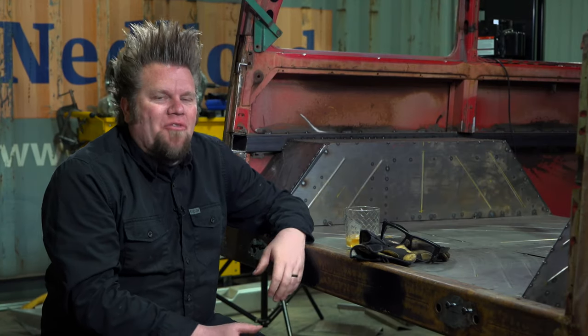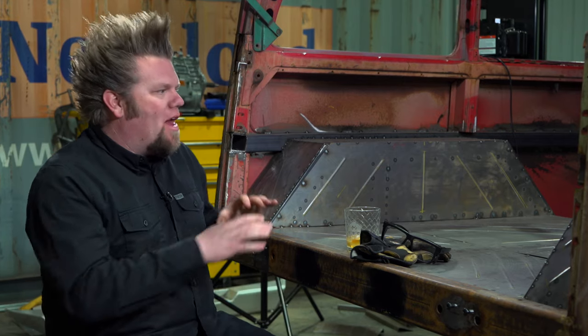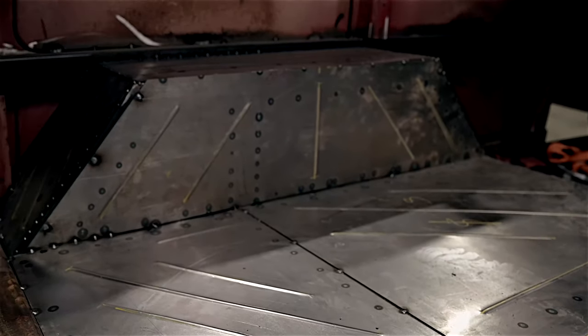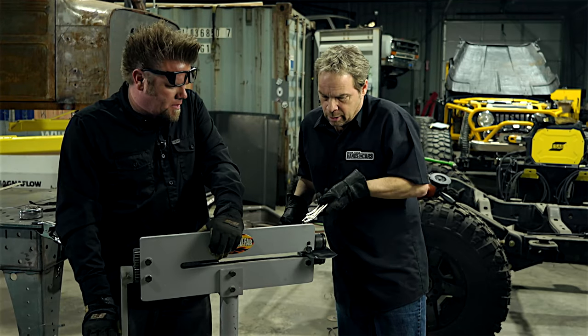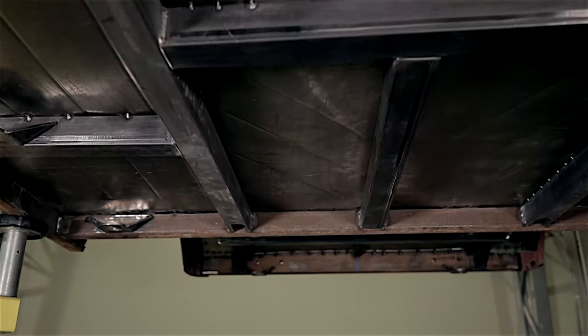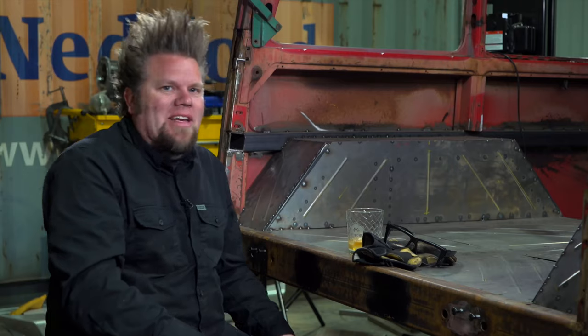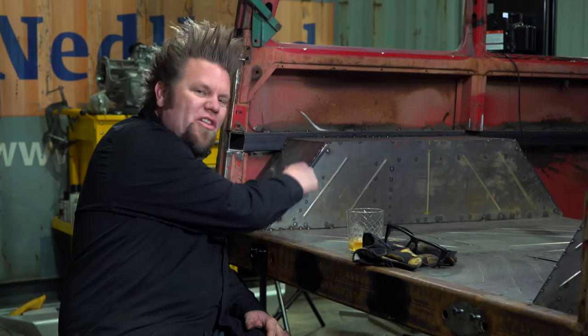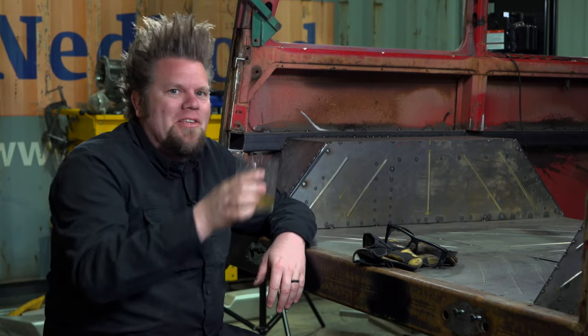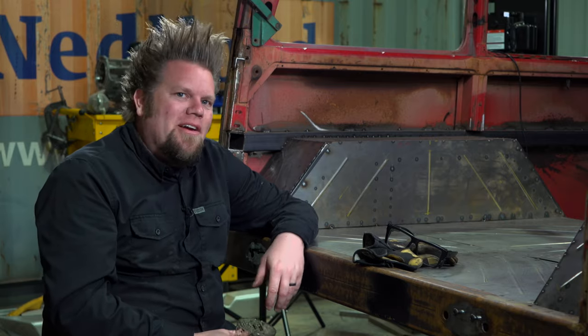I'm super happy to get the floor done in this truck today. I think I ended up with exactly what I wanted — basically a race cargo area, fender wells in the back, and had my buddy Kevin come over to help put all the bead rolls in. That definitely gave me the look I wanted. This really wasn't that hard — it was just time consuming. Had to make sure I had a good structure underneath, built it all out of that two-by-two 16-gauge, and now all the floor is tacked in. There's still some work to do — dealing with all the edges, probably some filler and seam sealer — but for today, this bad boy's done. We'll see you next time here in the Big Tie Garage.